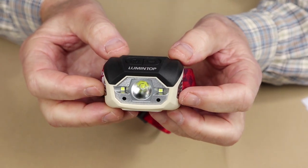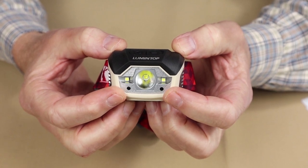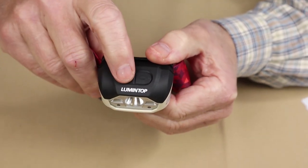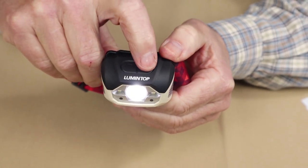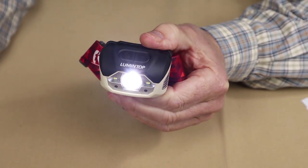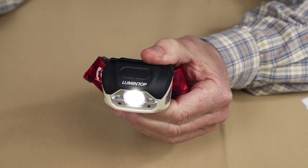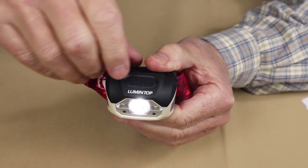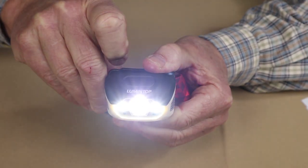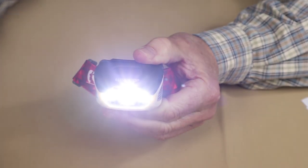Let's talk about the motion sensor mode. Just below each of the floodlight LEDs, there are two small dots — those are the motion sensors. To activate them, first turn the light on, then press the mode button. Now you can run your hand in front of it and the light turns on and off. In motion sensor mode you can't cycle through the lumen settings directly, but you can press the on-off button to select your desired setting and then re-engage the motion sensor mode.